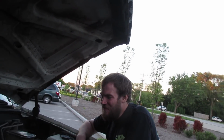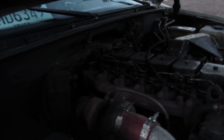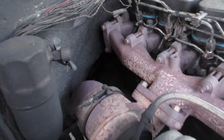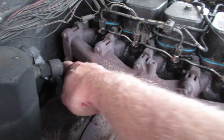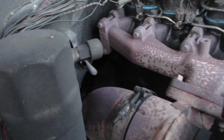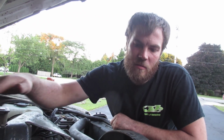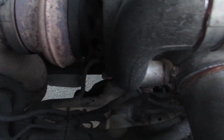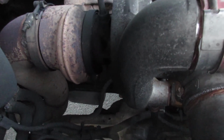Locked up on me. Honey, remember that truck that I bought? It needed an all new engine in it, and I'm not gonna put the original back in it. So did you have to notch the firewall? Nope. The only thing I had to do is the body lip. I just folded it a little bit. I didn't cut it out. I just massaged it, and the oil pan clears the front cross member just fine. I could probably put 2 quarters in between it.